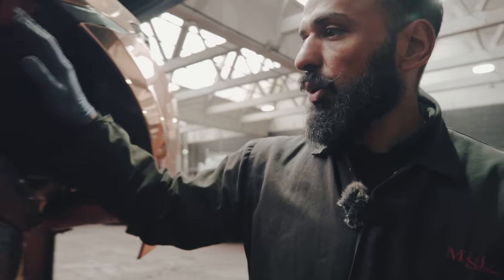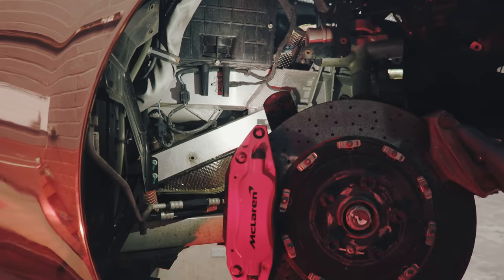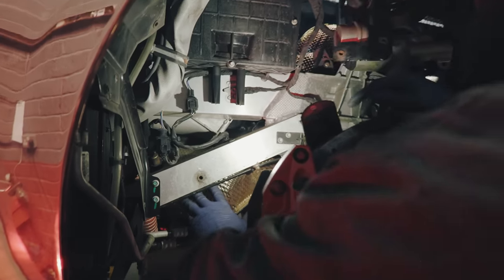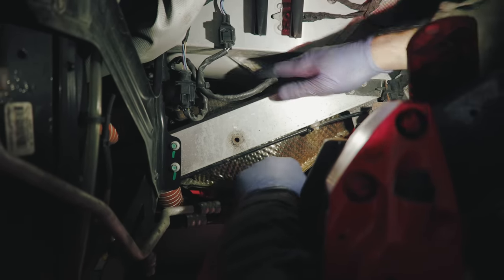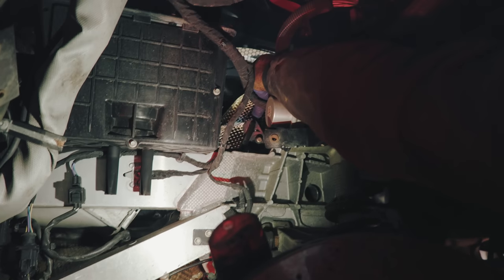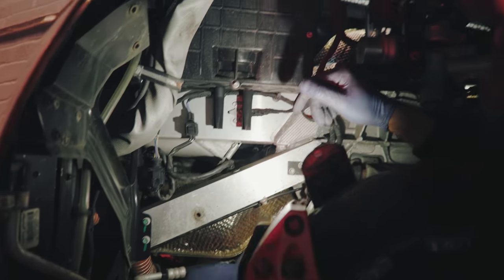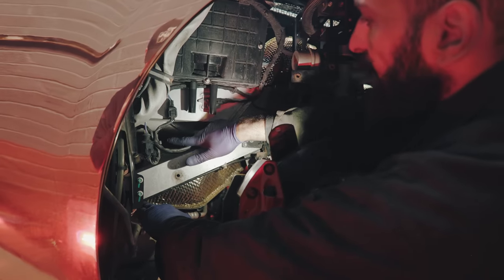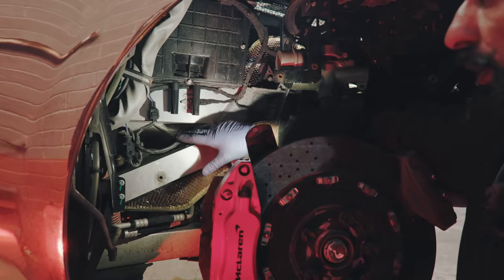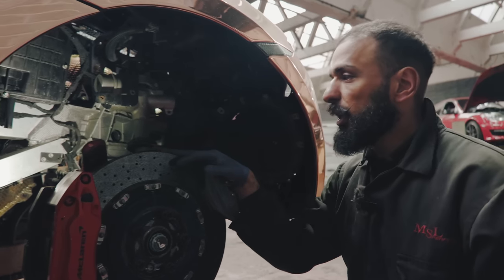So we've got the wheel off, wheel arch liner off, under tray off, diffuser off, gets access to it. Now, here's our downpipes, cats, whatever you want to call them, they run across here, they come all the way to the top. So next step is take this lambda sensor off, take this lambda sensor off, then hopefully open this bolt here, two around the back, hopefully they open. And then we'll unclamp it and slide it out at the top. So let's see how that goes.